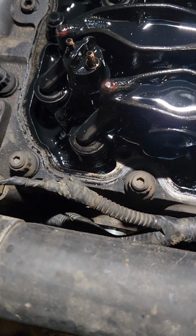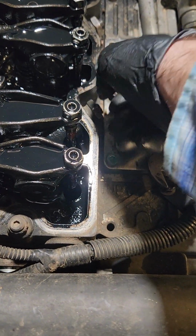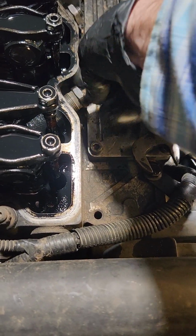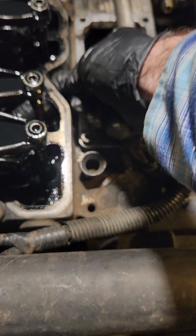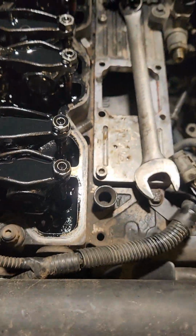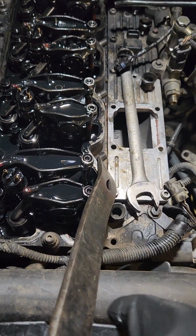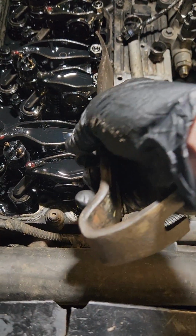But in the meantime, what you want to do on these connector nuts is go ahead and thread them out. I always just take them off. I don't worry about setting these really that much out of the way, because this is pretty much the last step here. You're going to pull that loose, and then you're going to wiggle that around until you get it to pop loose. We may have to get a pry bar. I'll show you how to do that here in a second, but I'm going to take the rest of these nuts off. So, I have this pry bar here. It was just a nail bar originally, and the end has been cut out with a really big notch, but it doesn't take much to just snap these suckers out.